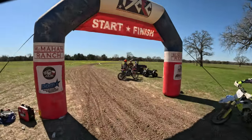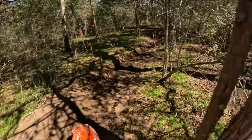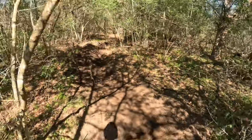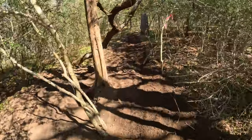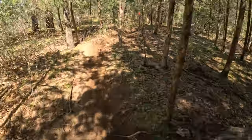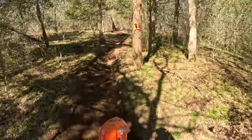I rode the bike, I broke it in, and then I ended up racing it at the TSEC Sandwinder Enduro. And it was pretty much in stock form as far as the motor goes. I had added my suspension, all of my gnarly roots kit and parts that I put on the bikes to outfit them for the season of riding and racing. I had built the bike out that way. I changed the gearing, went to a 49 on the rear, and I ran a shorter Akrapovic silencer at the time just to wake the power up.